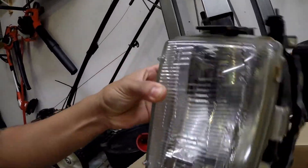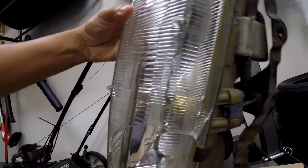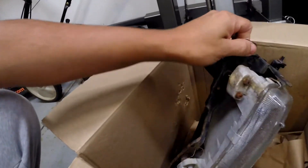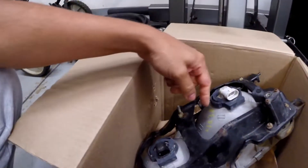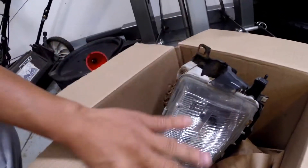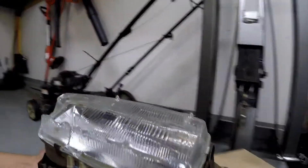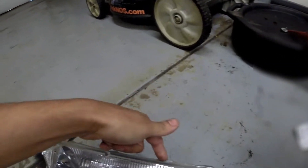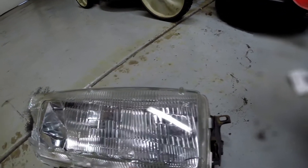This was donated to me from a friend — it was already cracked anyway. We're pretty much going to take all this glass off, take all the internals apart in the back, and probably drill out a 3-inch hole here to put an intake in there, make it come out of the actual passenger side so I can get just cold air intake itself. I'll show you the process little by little, and then I'll be painting inside of the housing. I'll probably be removing these pieces here, all the edges of the headlight assembly, and just start prying it out and work it from there.